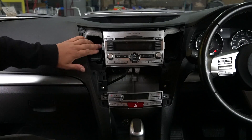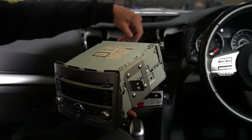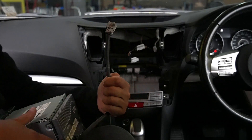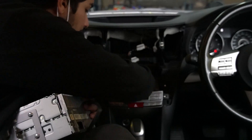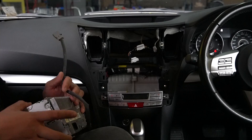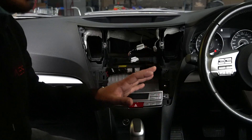The radio is held in by four Phillips head screws. When pulling the radio out, this is the antenna cable - it's a bit annoying because it doesn't unplug from the back of the unit but actually runs down to a little clip. You have to pull the clip out and then unplug it. Don't lose that plug because that's your antenna adapter - you'll need to use it.